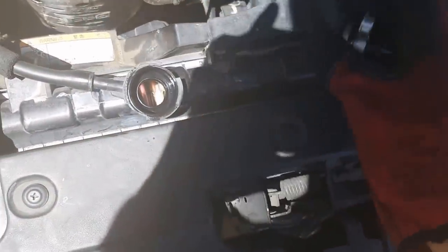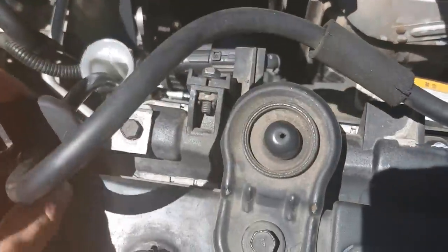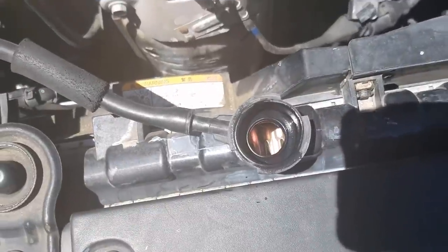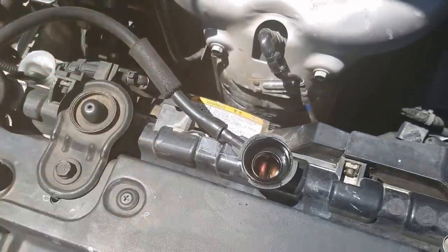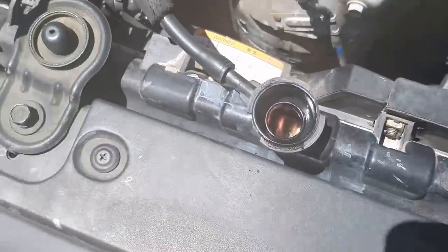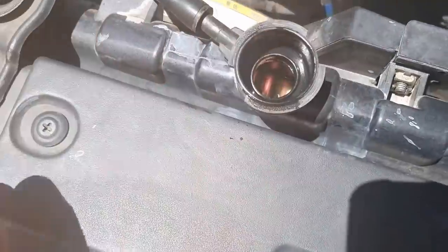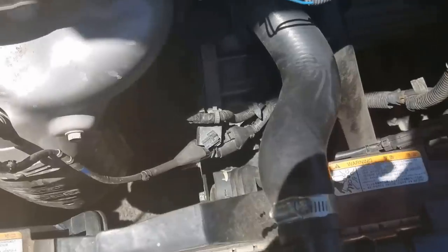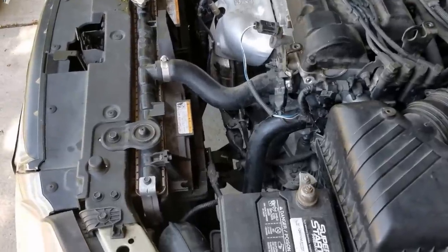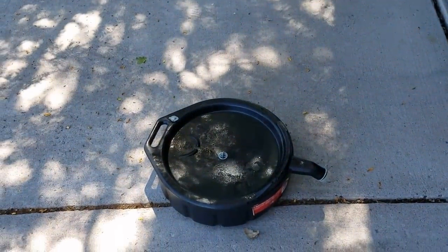Remove your radiator cap and just let the engine run with the radiator cap off and your coolant reservoir tank also open. Run it like that for a while. What'll happen is it'll bubble up, and you can have your coolant nearby and just keep pouring it in as it goes down. Eventually it'll stop. Right now my reservoir level is just at that top line that says full. You want to make sure you get all the bubbles out of the system. You could even try squeezing the hose too, but use gloves because that stuff burns. Remember to properly dispose of your fluids — oil catchers are not good for that. Use a bucket.